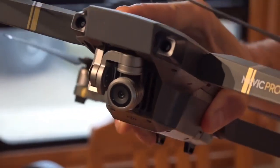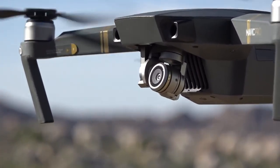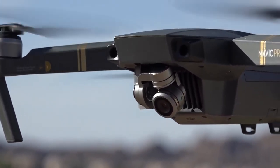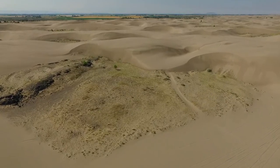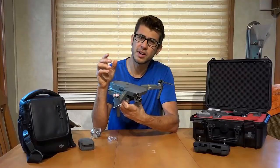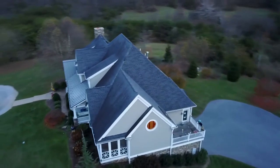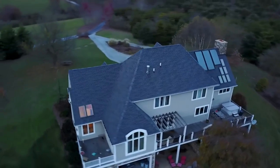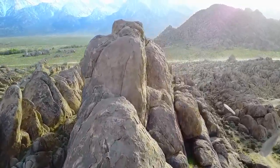The camera can point straight down all the way up to about 30 degrees above the horizon. The camera on this drone has a 12.35 megapixel sensor, and it can take pretty high-resolution pictures and shoot video up to 4K. The sensor is a 1/2.3 inch sensor, so it's not great at really low light, but if it's a bright day, it captures some pretty stunning, sharp-quality pictures.